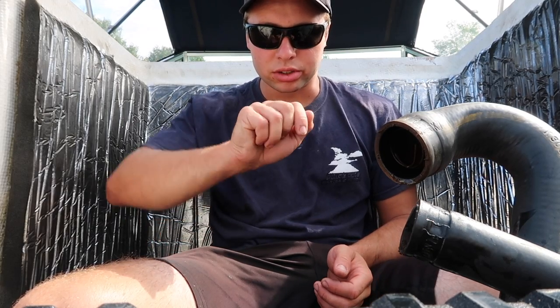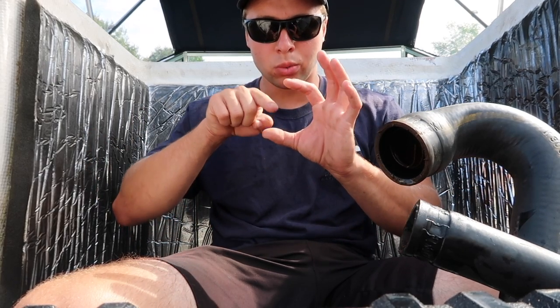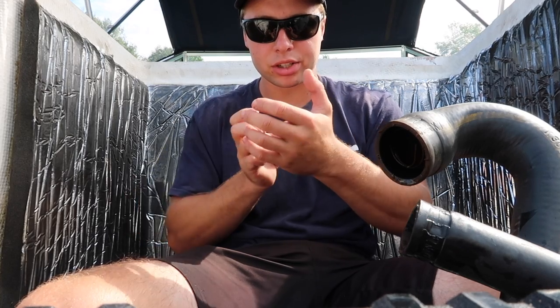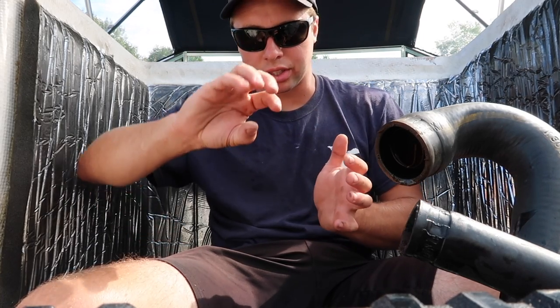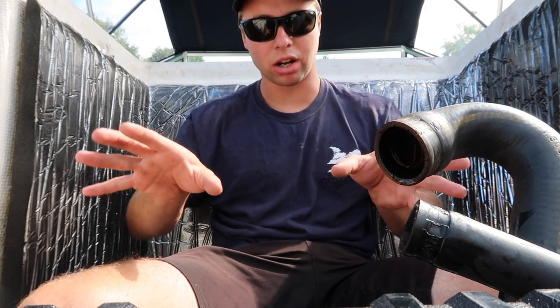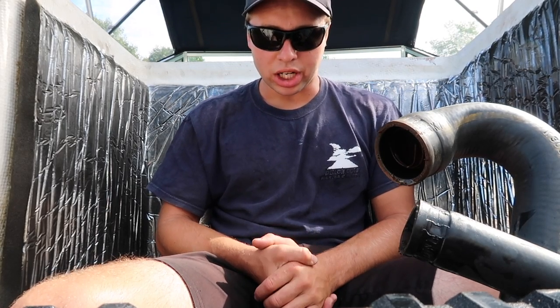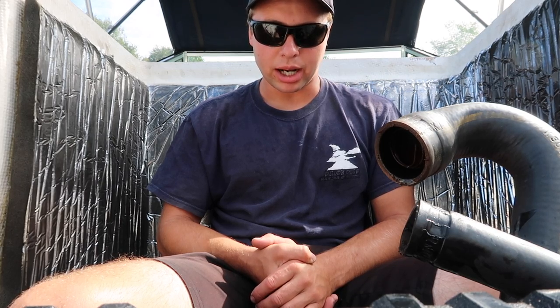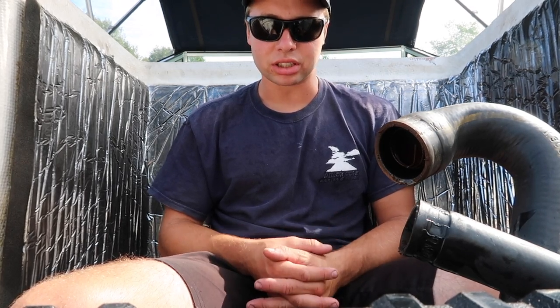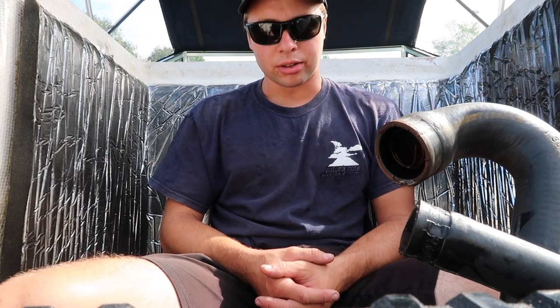Make sure that power steering cooler is drained and pink comes out of it when you pour it in. What I do is give the motor just a little turnover quick once it's done draining. Some people may disagree, but your impeller has water between all those fins — if you give it a little burp it twists that out, and it won't hurt your impeller. There'll be lube water in that line still so it'll push that all out. Hopefully this helped you get your boat winterized and you'll have a reassured winter knowing your boat won't freeze.